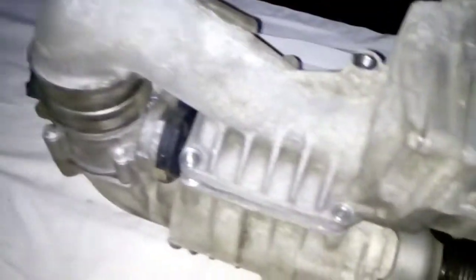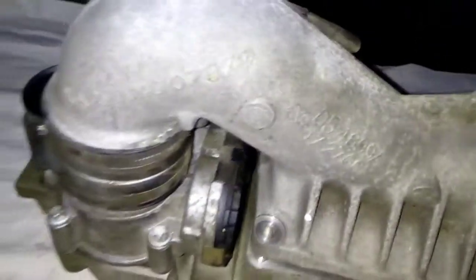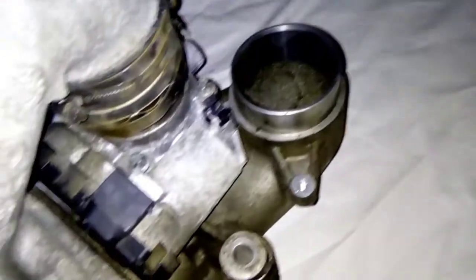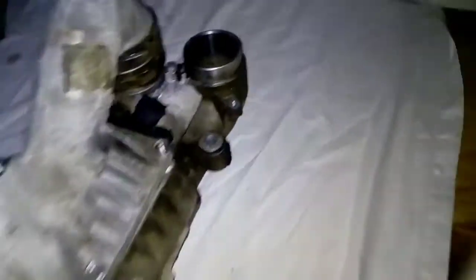This one is the M65, where you can see they integrated the bypass valve off the output into the input in one unit. This is a six-pin unit, basically what could be described as a Bosch throttle body, with inbuilt location sensing via the six pins. Quite easy to work with on most aftermarket management systems. It's a quite compact unit — not as compact as the old one, but does a fairly good job of staying small.